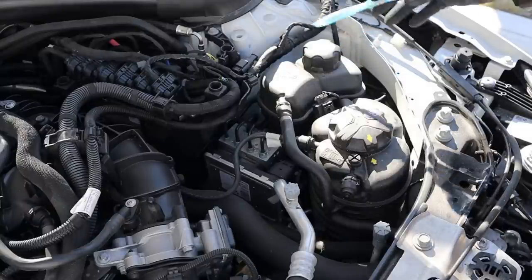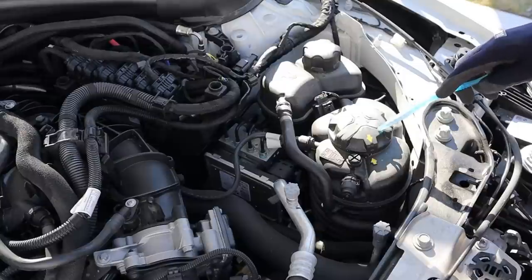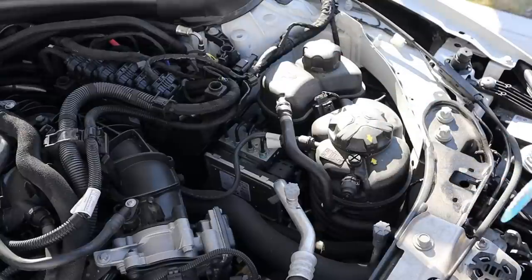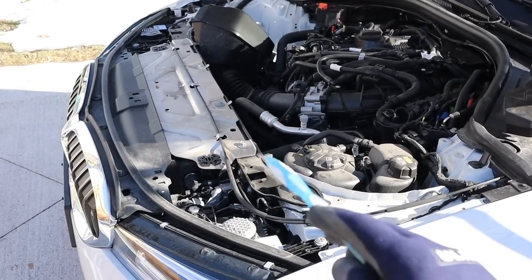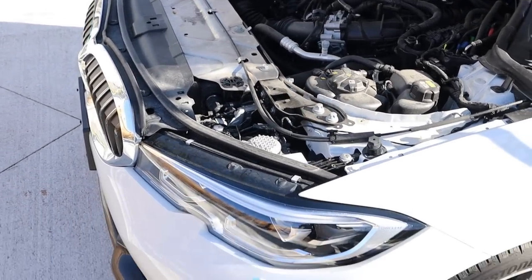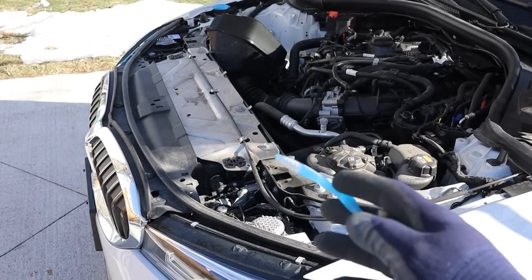The 3 Series cooling system is a little more complicated. There's one circuit for the turbocharger intercooler setup and another circuit for the engine itself, with respective reservoirs. The radiator is located on the shield at the front. One cool thing is that you don't have to remove the entire front fascia to access the radiators or the radiator fans like many other vehicles.